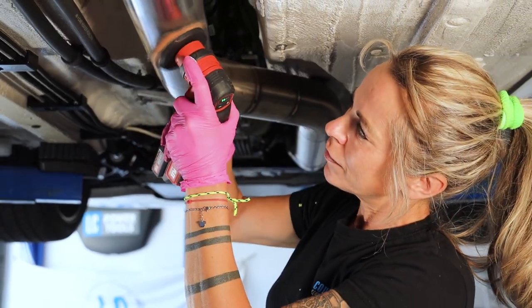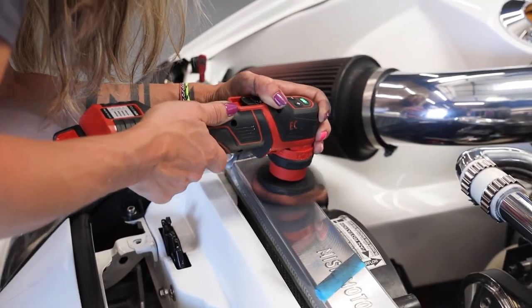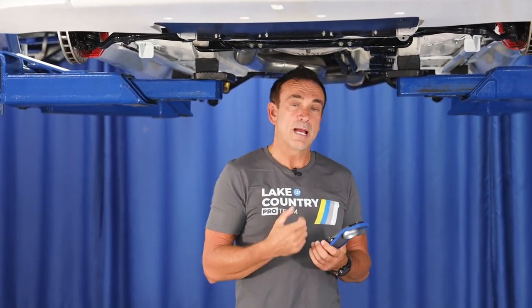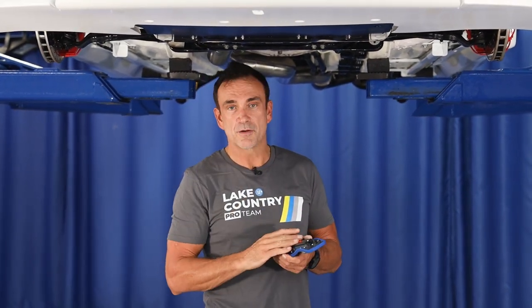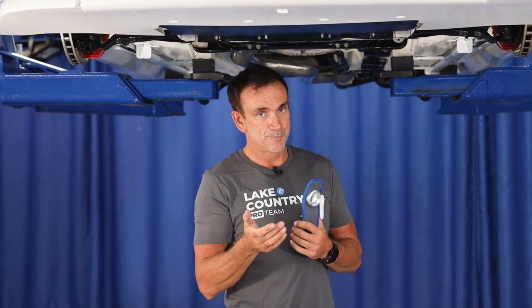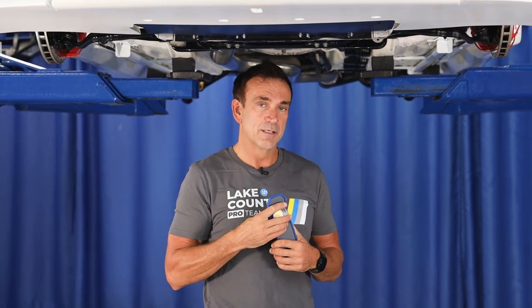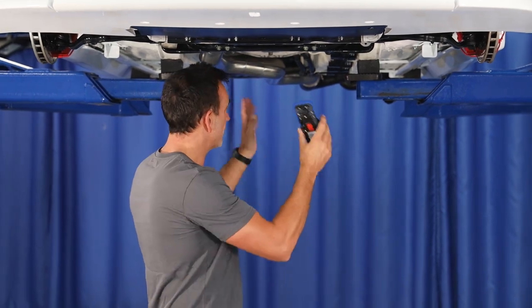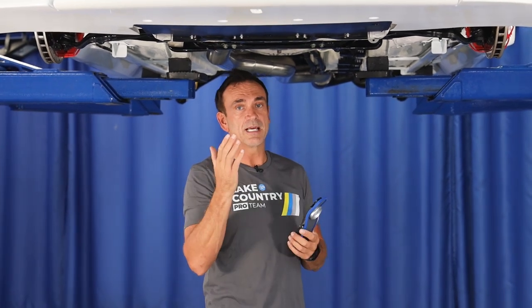There's been some polishing going on as well underneath, but this actually is a huge labor intensive job. So is the engine bay. We've used microfiber cutting pads, we've used some finishing pads, and we've used cutting compound, but a little trick here, we've then used our one-step orange HDO cutting pads, one-step microfiber pads, and used metal polish. We've tried a couple of brands and they all seem to work very well on anything that's bare alloy. So it includes the wheels, the rims, all the engine components, and if there was anything bare underneath here. But the rest of the painted areas, obviously we use normal cutting compound and then coatings.